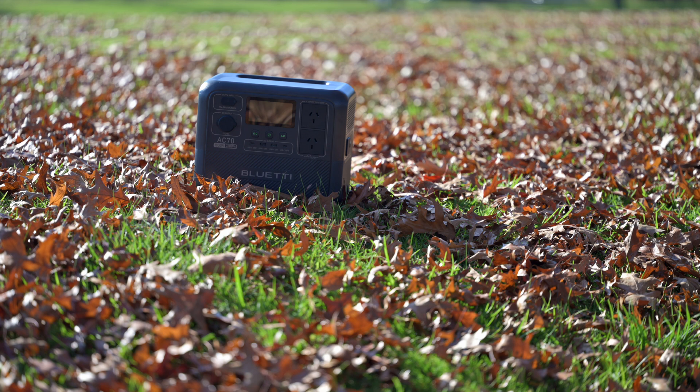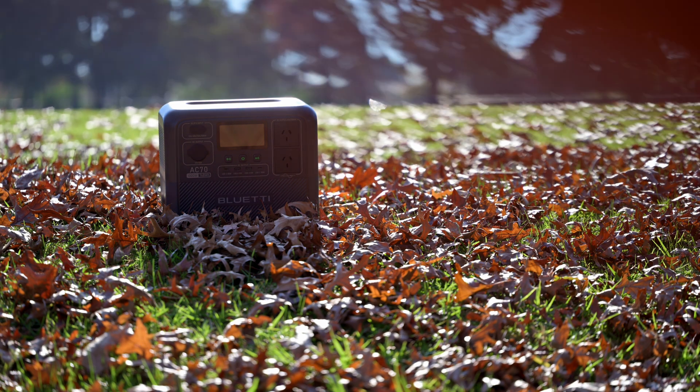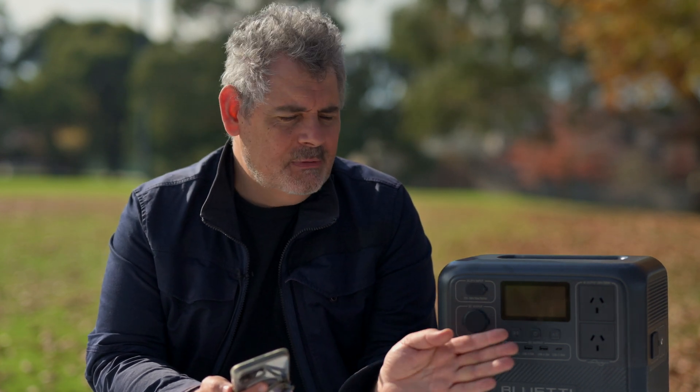This unit is 768 watt hours, two times 230 volts, and 4.3 amps, or a thousand watts in total per hour. The maximum output is 950 watts. So for example, if you plugged in your vacuum cleaner that might run at something like 2,400 watts - they are some of the heaviest things we use around our houses - you can't run that off this. So there are some limits. Kettles, for example - you can get lower wattage kettles. This particular battery is a smaller one; it's not a catch-all battery, but it catches a lot.